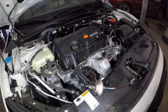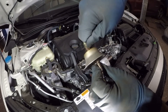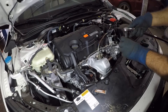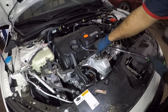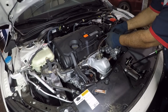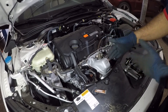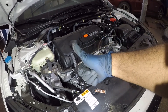Once all this is done, you need to put a little bit of anti-seize around the threading of the sensor — spread it all around nicely and evenly. After that, take the sensor, insert it into the hole, catch the threads, and tighten it. Tighten it to where you think it's good — just snug, nice and tight, but don't go crazy. After that, plug the sensor into the connector until it clicks, and make sure you connect it to the little bracket. There's another sensor down below that's very simple to get to — you can remove and clean that one as well. Thanks for watching, don't forget to subscribe, share, and like.